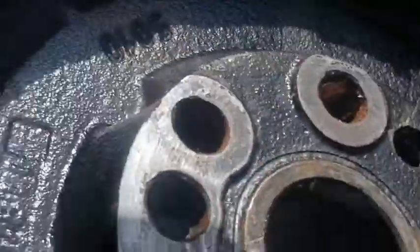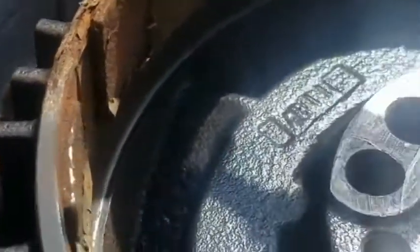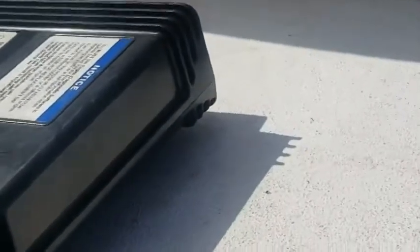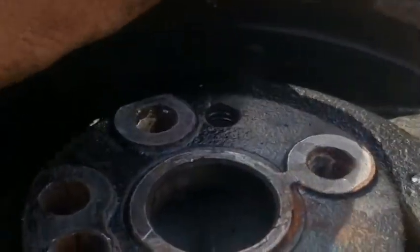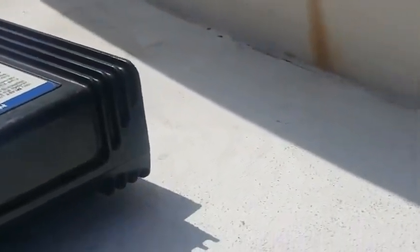There are two of them right here. These magnets are polarized — north and south — so they have to alternate north to south. They're super strong; the metal just sucked them right up. We're missing a couple, and a couple are together. So that was our issue. We're going to clean this up. If you have a lot of them off you may want to run through them all, mark them one and two, and alternate them when you put them back on so they repel — so that one goes here, this one attracts, keeping the right sequence.